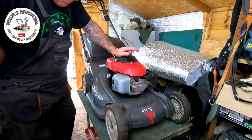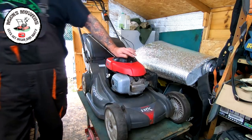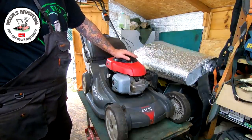We're taking it outside and giving it another run - hopefully it won't knock like it did, and the pull cord won't be quite so short. I've got to do a service on it - it's already had new oil. I've got to do a blade sharpen, air filter, and possibly a carburetor clean. Let's take it outside for a quick run and see if it doesn't hunt and muck about.